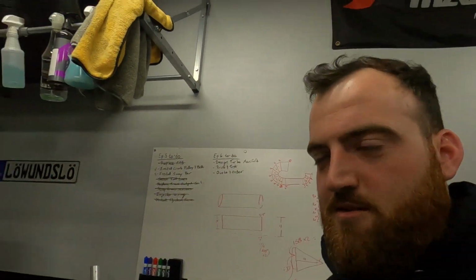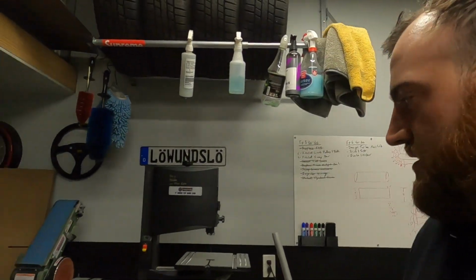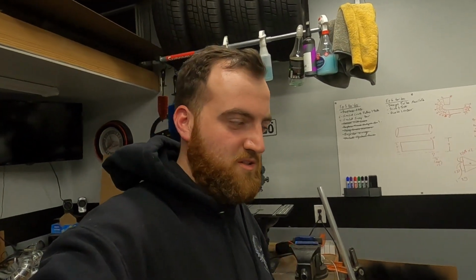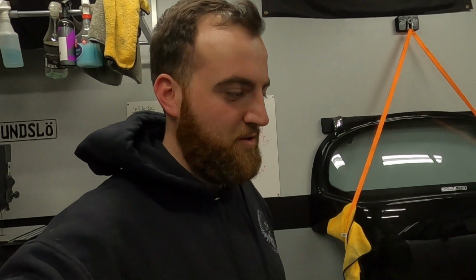So it's almost 11 o'clock at night, and this bandsaw doesn't do anything for stainless. So I bought a Milwaukee Portaband like an hour ago, and I'm gonna pick it up at Home Depot tomorrow, and we're gonna make some cuts, put some pieces in, and try and fill the gap tomorrow. It'll be fine because it's gonna be in that lower section. It's just gonna need to be manipulated a little bit, maybe like a pie cut this way and a pie cut that way, just to get it to kick over enough.